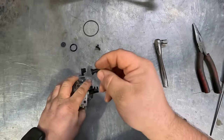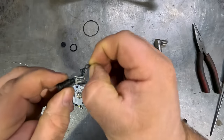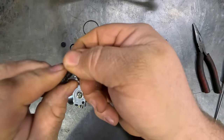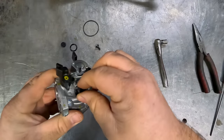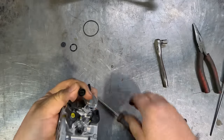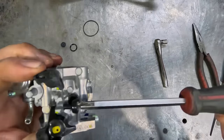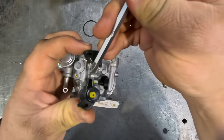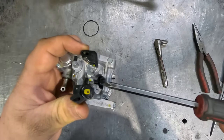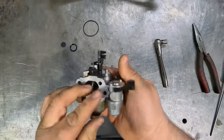The idle jet — that little rubber O-ring: grab it and pull that old O-ring off, then take the new one that comes in the kit and slide that one on. Just pop that jet straight back in, and pop the idle screw back in just till it hits the little throttle there, so you can adjust the idle later. That's it — your carby is together.